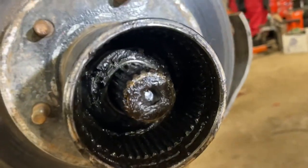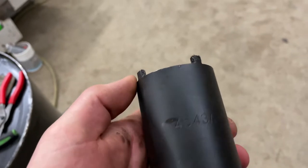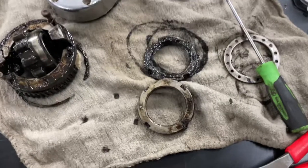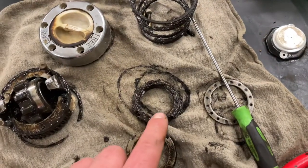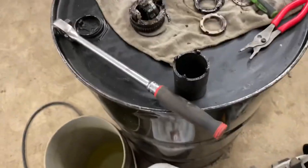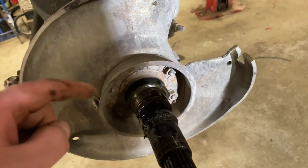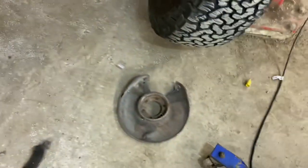This is the inside. There is a big nut in there holding all that on, so I'm going to undo that and take the rotor off. This is the socket I use to do that. There are two nuts in there I pull off — this is the back one, it has this little locating pin. There's a washer in between, and here's the outside one. They're not on there super tight; a smaller half-inch bar will get them off. To get the U-joint out now, these bolts all have to come out and we have to remove all that to get the U-joint out. You take off those bolts, then you can just hit the shield off.